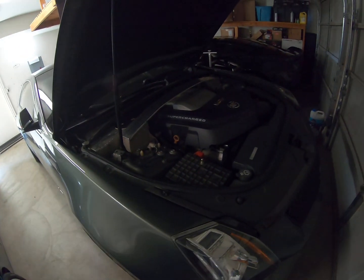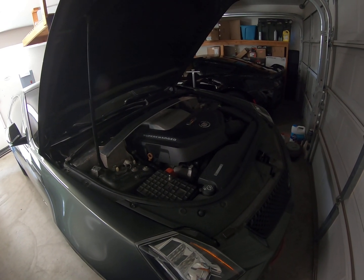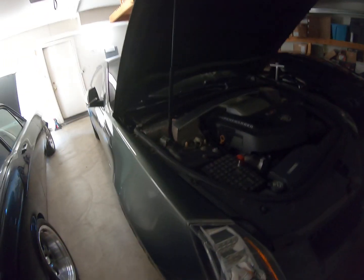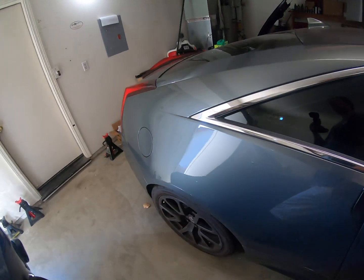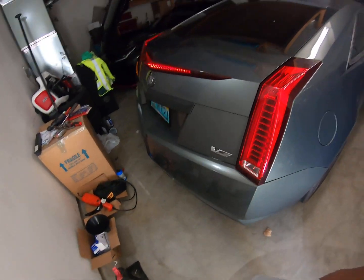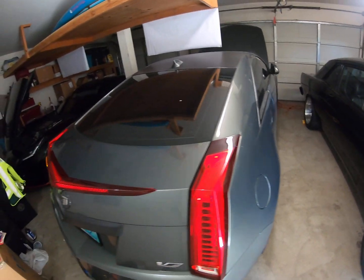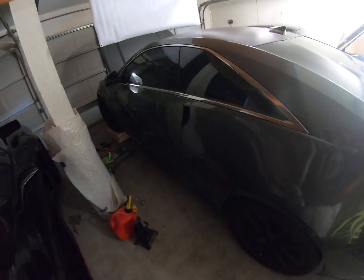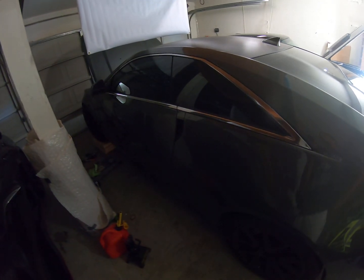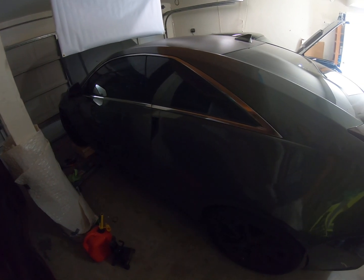This thing put down 569 horsepower and about 560 torque, so again, this is a very mild tune. In the future, I'd like to do a cam, swap over to E85, do a lower, and pretty much push the stock LSA to its limits. Typically these things will see anywhere from 750 to 800 at the wheels all out on the stock blower.